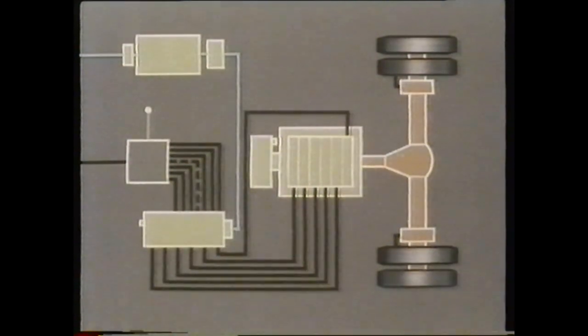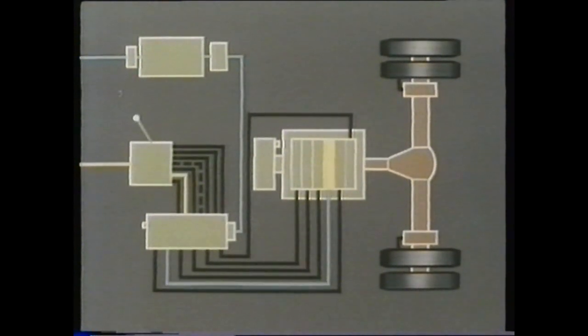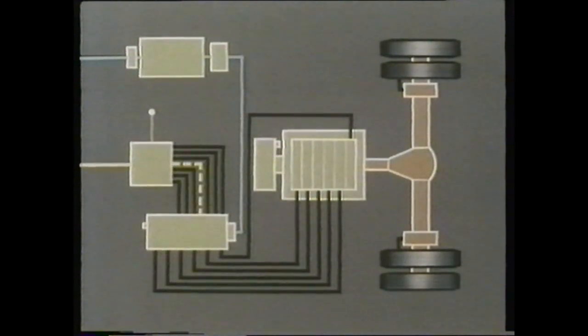An electrical supply is passed through the change speed unit. It's the change speed unit which, on manual selection of the appropriate gear, will send an electrical impulse to the electro-pneumatic unit, where a solenoid will come into operation to release air from the EP unit to the selected gear within the gearbox. For maintenance and fault diagnosis purposes, take particular note that a neutral wire runs from the change speed unit to the plug that takes the electrical impulse into the EP unit. In addition, on some models, there is an intermediate connection between the change speed unit and the EP unit.